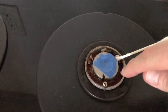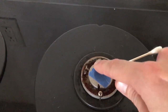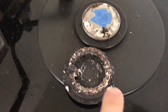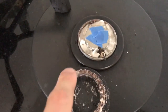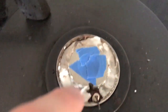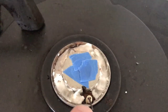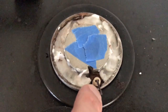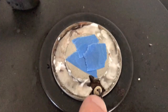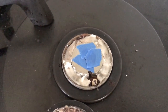I'm using the q-tip to get into the edge. For safety, I used blue painter's tape to cover the hole — you don't want anything dropping down below. I took the steel wire brush, roughed up the area, and coated the rust and corrosion with that baking soda and vinegar mixture. I stayed away from the actual igniter opening. I recommend letting that sit for about 20 to 25 minutes.